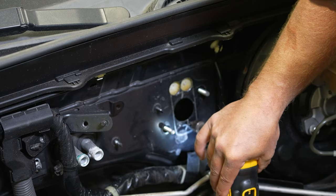So light pressure and twist, there's no ring on the lower part. So we're going to push that down into position and then tighten the hose clamp. All right. So now we can hook in the reservoir line, which runs down to this top port of the master cylinder. So you're gonna put your clamp on, make sure you do it in a direction that's gonna be accessible.